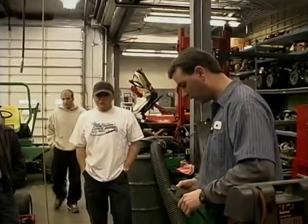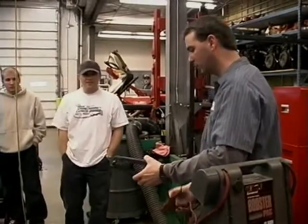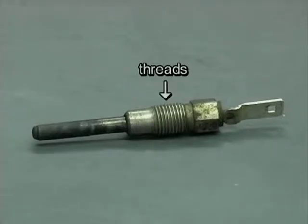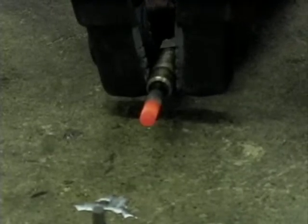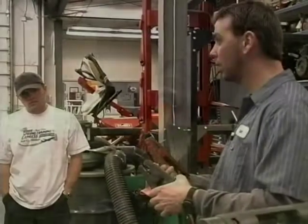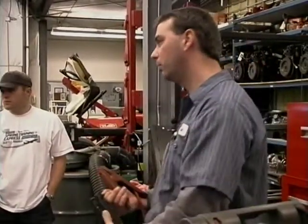It should start the first time if you use the glow plugs, or the second time. Now I'm going to show you how this works — this is a good glow plug. If I want to test to see if it's any good, I put 12 volts into the threaded part. The threads that you screw into the head are the ground — I have to have a complete circuit, so the threads are my ground. I put the negative on the threads and the positive on the tip, and if you start counting, it should glow red within 10 to 30 seconds. Most glow plugs have different numbers indicating how fast they glow — some glow in 10 seconds, some 20, some 30, some in 60 seconds, but most are within 30 seconds.